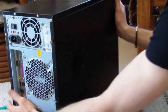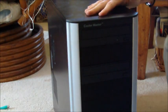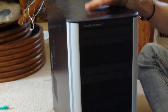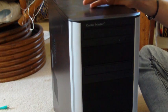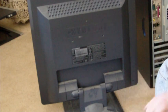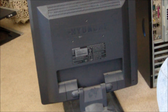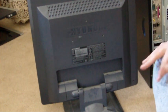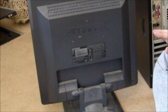And that's it — you have your finished computer, all nice and shiny and ready to go. Now we need to hook up the monitor, keyboard, power to the outlet, and our mouse. All we've got to do is hook up the cables between our monitor and our new computer. Get one of the power cables and hook it up to the back of the monitor, then get out our display cable — either the blue VGA cable for an older monitor, or the white DVI cable for a newer widescreen one. Plug it in and screw in the screws on the side so it stays secure.